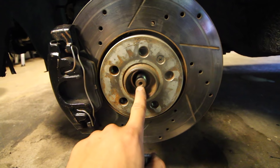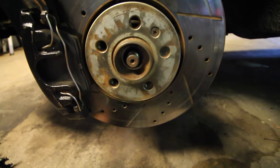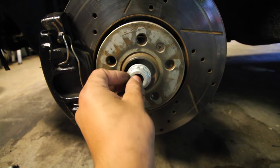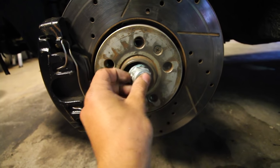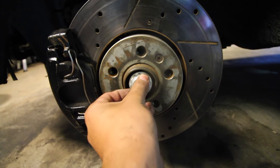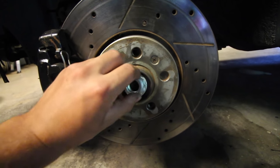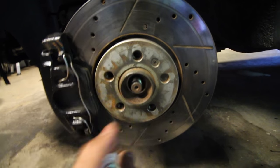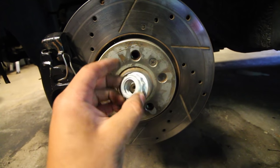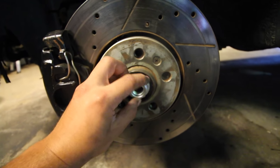When installing the axle through the hub, make sure you get rid of the old bolt and install a new one because these bolts are only meant for one-time use. Once you put them on and torque them properly the threads inside are going to stretch, and if you reuse it and torque it a second time you're not going to get a proper torque spec — it's not going to be gripping and pulling the axle onto the hub properly. They'll cost you a couple bucks at the dealer, so spend a couple extra bucks and get it done right.